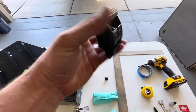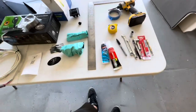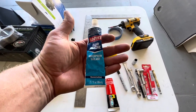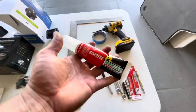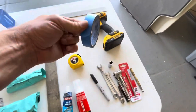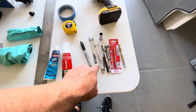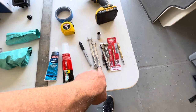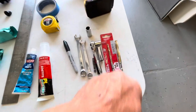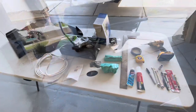Using this kit, there's no big holes that you need to drill on the inside of your boat. A couple of tools you're going to need to complete the install — you'll need to purchase or supply these: some clear silicone, Loctite, marine adhesive sealant available at Home Depot, a tape measure, painter's tape, an impact drill, a half-inch wrench, a 7/16-inch wrench, and a couple of sockets. We will include the 7/32-inch drill bit and a 3/8-inch drill bit, and that's it — you'll be able to complete the install using those tools.